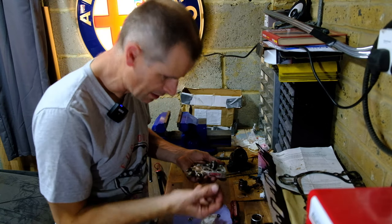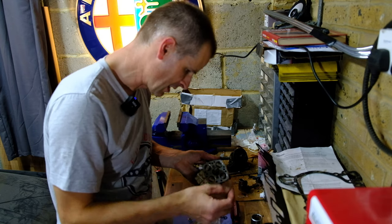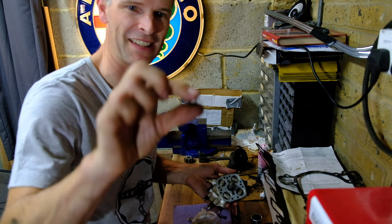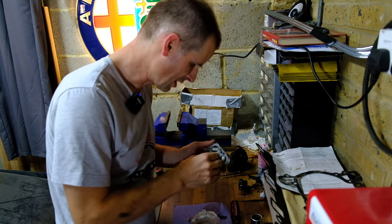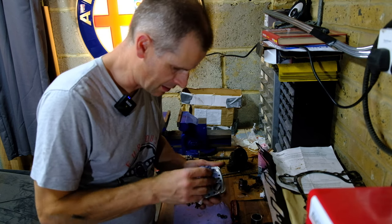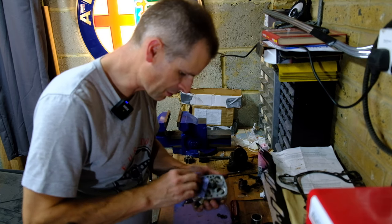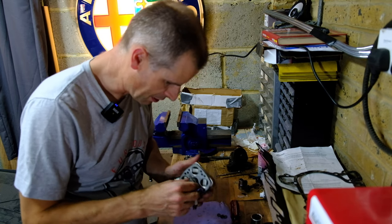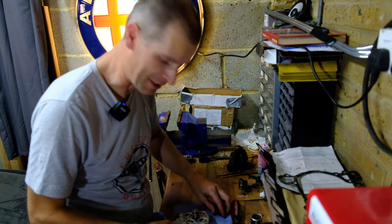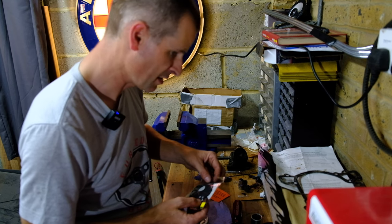So these little rubber washers, what do you call them, O-rings, they are spent. They should be tiny and rubbery, elastic and tight, but they're not. They are terrible and old. It says not to use carb cleaner on this because it will dissolve many of the components. Use petrol, and one thing there is an abundance of on here is petrol, so that's all right. Okay, wash the diaphragm in soapy water before fitting. I did not know that.